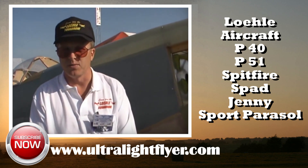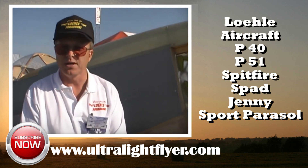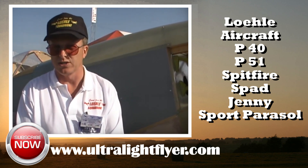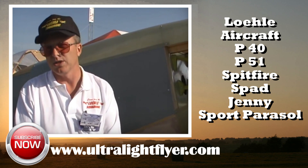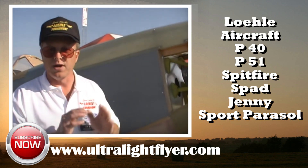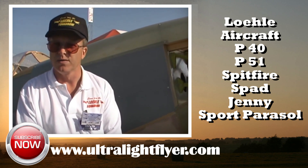Presently the airplane is being set up with the Rotax 582. The long range goal will be the 912 as an option. On all our replicas — the World War II line — the problem has been with the horizontal engine such as the 912: the width of the cowling area, trying to keep the engine enclosed and not spoil the replica look. Once we've gone over to the fiberglass cowling arrangements, we have the capability of spreading them out slightly and still keeping the look, and at that point we'll be looking at the 912 also.